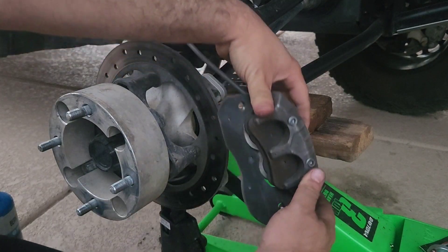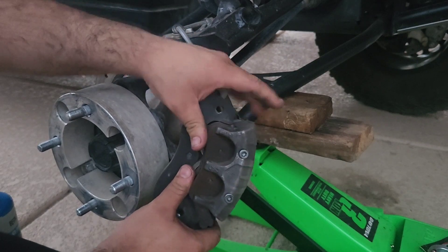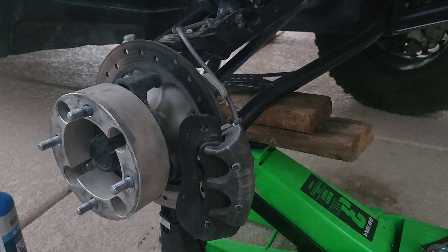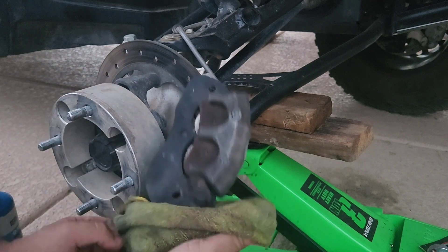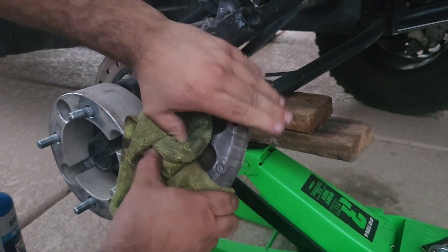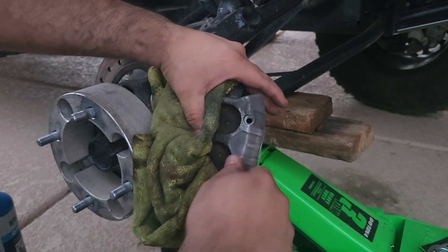In order to remove these pins to allow the brakes to come off you kind of have to push the brake up a little bit. It's still kind of hot — let me grab a little rag. I turn it and it comes off. There's one pin, and they do sell replacement pins that are Allen heads instead of torx bolts.